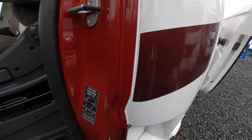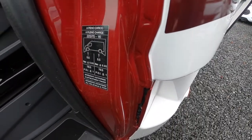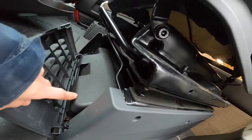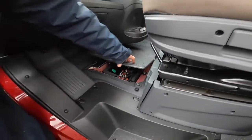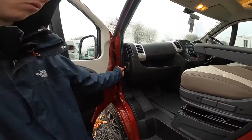You've got your tyre pressure — 5.5 bar all round, which is 79.5 psi. You've got your tool kit underneath your seat, so it has a jack, wheel brace and a tow eye in here. Underneath this compartment here is where your engine battery lives. Should you need to be underneath your dashboard, this is your dashboard release there.